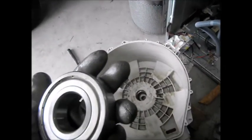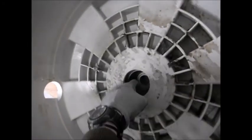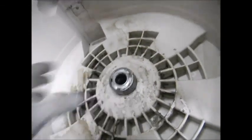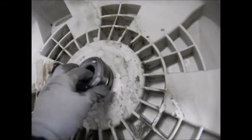We've got them pounded out. This is a new one. We can use the old bearings to pound the new ones back in. You want to make sure this is nice and clean in here — no debris buildup. Line that up; it kind of centers itself a little bit. We definitely don't want to push on this part or this part here. That little center piece just falls in. So you can use a piece of wood on the side — you have to get it in there nice and even. You've got to stay away from this center part and pound it in like that. Get yourself a block of wood and pound it in that way. Make sure this doesn't get stuck inside of it.